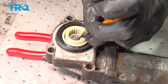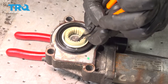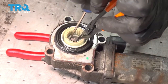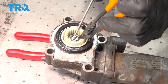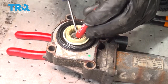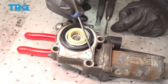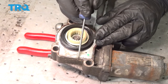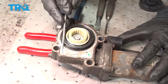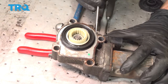Removing this clip can be one of the hardest things you do about this job. Now with that clip off, we can continue on to this plate. If you look along the casing close to where the plate is, you're going to find a whole bunch of dimples around it. Each one of those dimples is an area where the casing was driven into the plate to hold it in place. We just want to take a hammer and a punch and carefully try to knock this away — it's important to make sure you go ahead and knock all of them back.